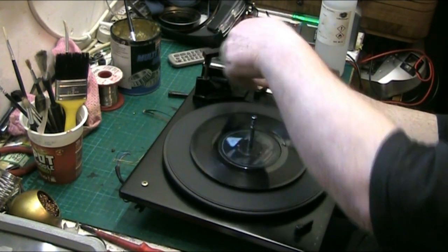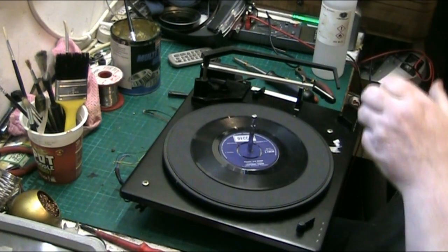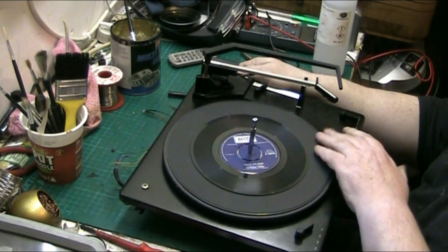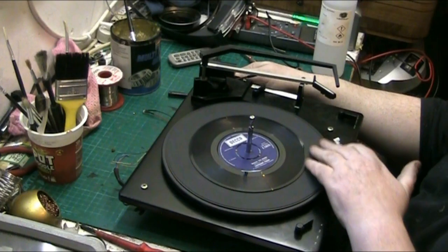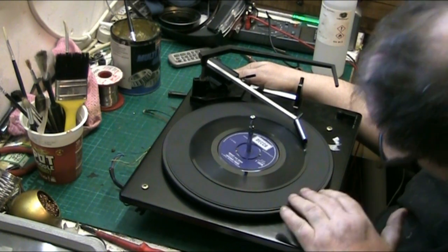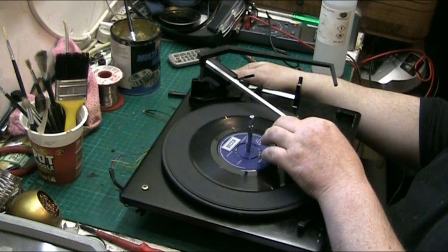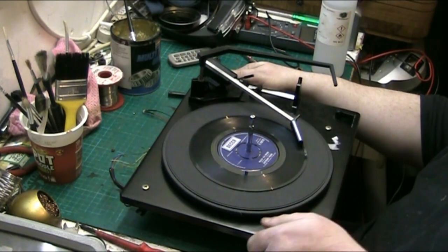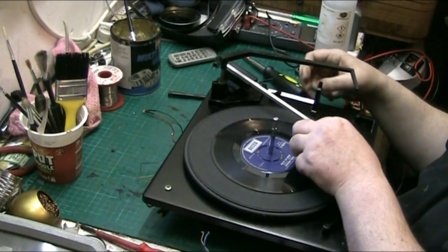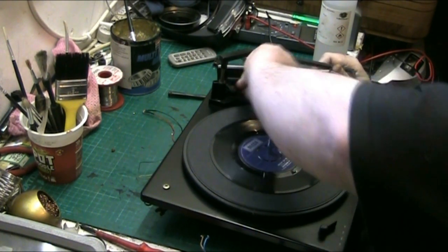Make sure that the stylus point will actually drop onto the first record. We don't want it sitting too proud. Don't want it sitting too high, otherwise it won't work. So we'll just put it on and operate the mechanism, and we can set the height then, because otherwise I think it won't sit on a record. That needs adjusting slightly. Is that on there? Ooh, well and truly. We can even afford to go a mouse's midge higher. Let's try that.